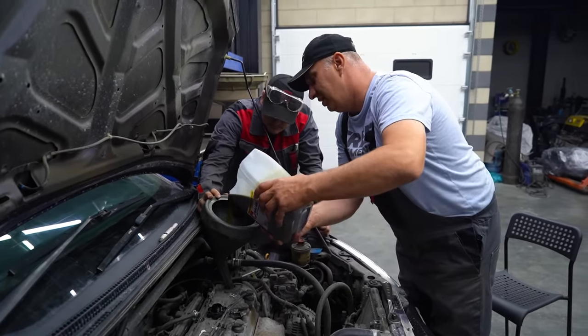That's enough. Half a kilo drop in fourth. Up to 16 from 15. Once again, an increase of half a kilo. No changes in cylinder number one. So this might have even had some kind of minor effect. We didn't drive far — we could let it sit and run. Or even better, why don't you drive around today, and tomorrow morning when you get back, we can try something else and we'll do another checkup. And if the engine seizes, you can give me a call.